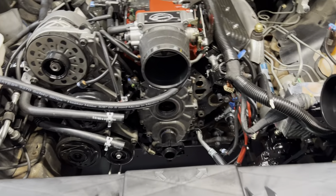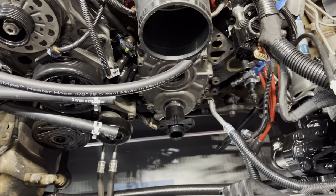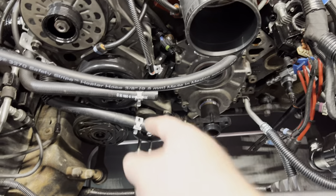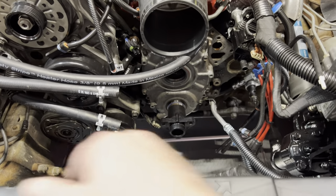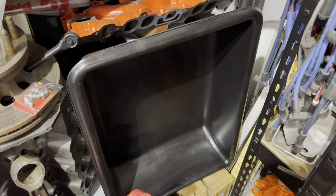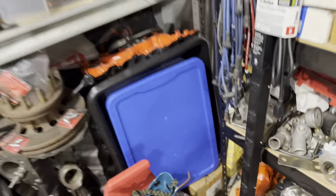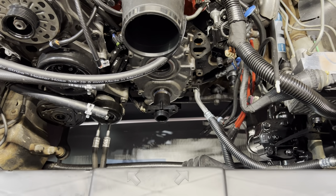When you're going to take the coolant out of this car, make sure you have a tub or something that covers the whole area underneath, because I went to drain the petcock and — like any car I've done, petcock, low radiator hose — a little will come out of the heater hoses, but man, it gushed everywhere. Go to Walmart or Ace Hardware and buy two of those thin-wall garden tubs — maybe seven dollars each — put them side by side underneath there and that will significantly reduce the mess.